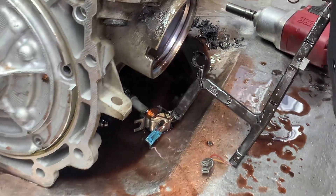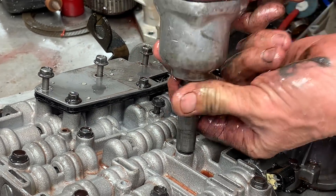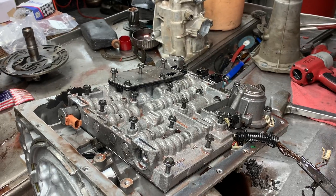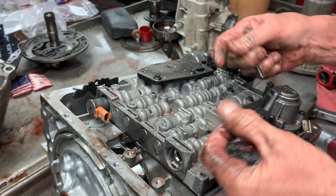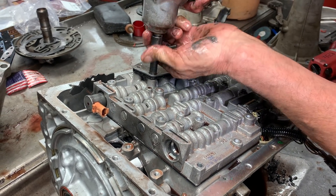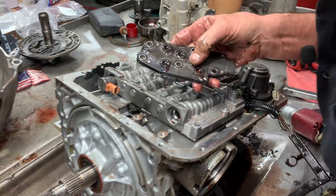This thing is so contaminated with metal — all the sensors, pillow pad, everything will be replaced. There's nothing savable. Even after we get this tranny rebuilt, we'll drop the pan on it, drive it for a little while, get it warmed up and flushed out good, then drop the pan and do another service before we even deliver the unit. Because even cleaning it as good as I clean, it's hard to get all the microscopic pieces out, but that new transmission fluid will.